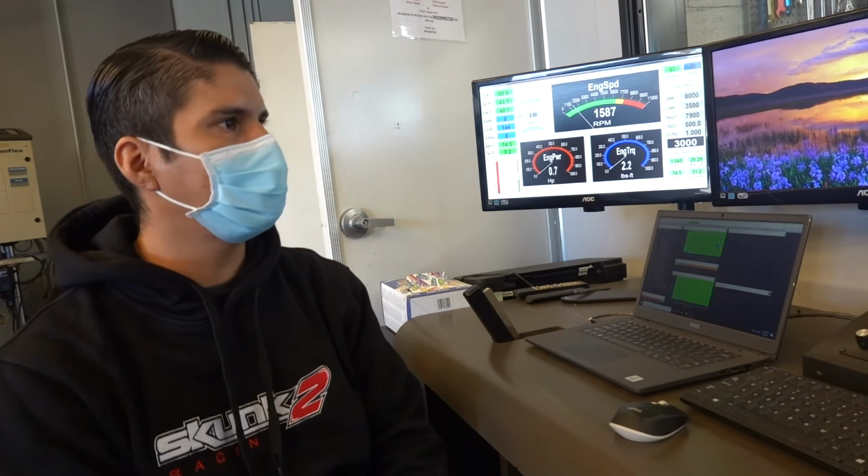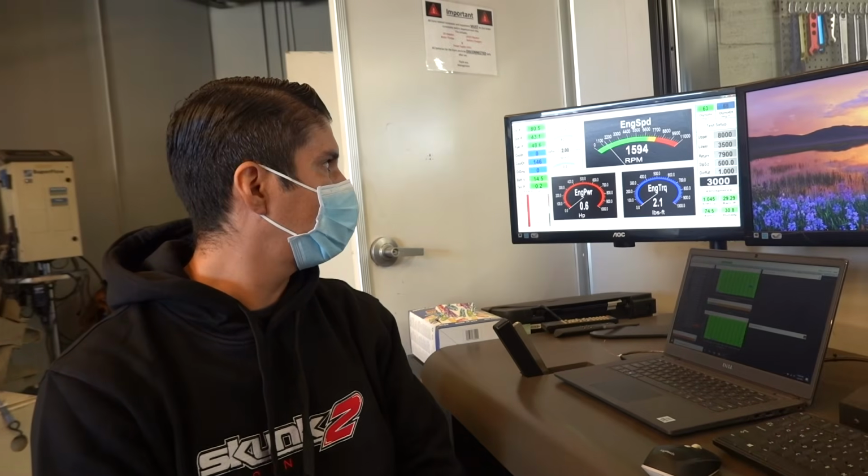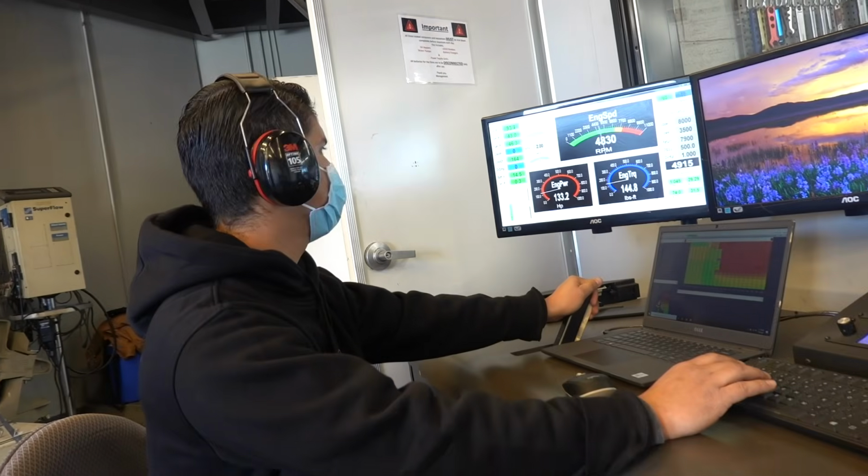So that was holding 3,000 RPM for a little bit, right? Yeah, just to put load on it so it can seat the rings. Once we do that, we're gonna let it warm up a little bit. Then we're gonna start making some quick pulls from 3,500 to 8,000. And you've got no cam control in there right now because we're gonna mess with that later. Okay.